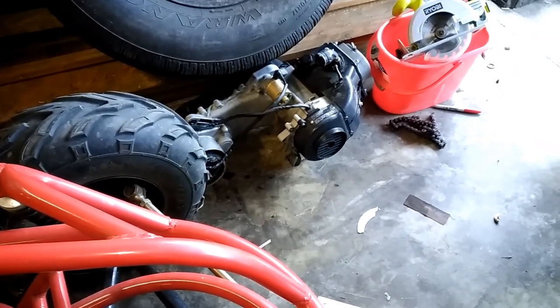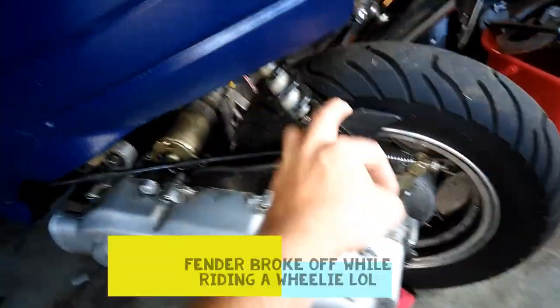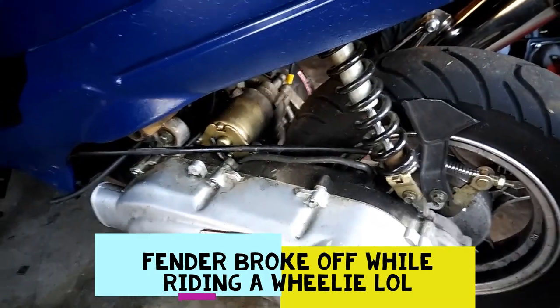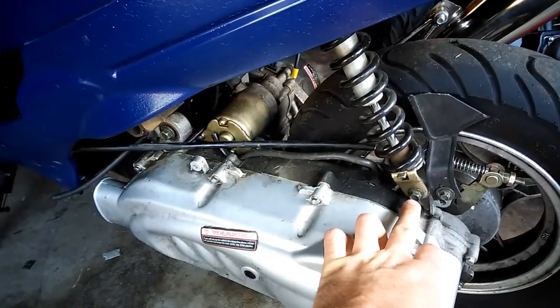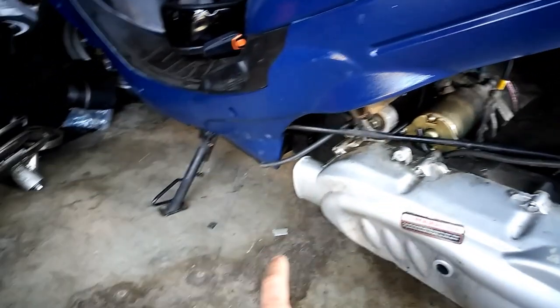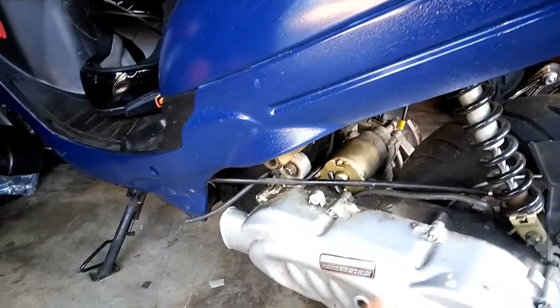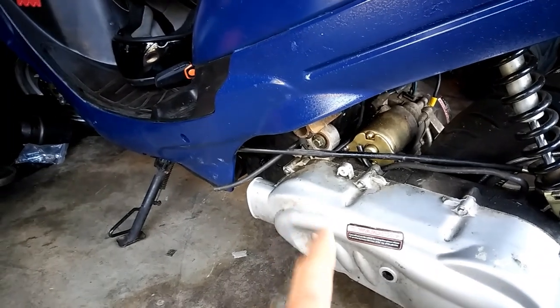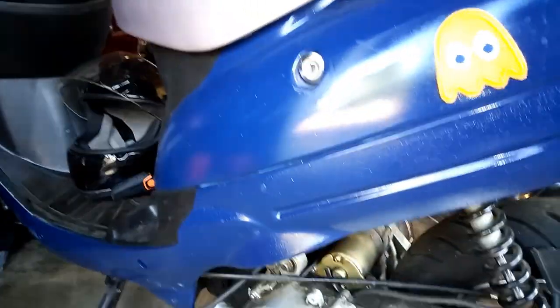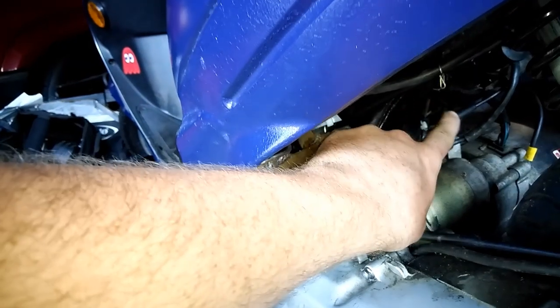Here's the 50 and here's the 150. I've gotten a couple questions as to how I did this. These engines are pretty simple. They're held in with one bolt — the motor mount bolt here on the 150. On the 50, you've got your motor mount bolt up under this area here. So to make this go from a bottom to a top mount frame, as you can see, it is just a little 50cc frame. The 150 has this bar for the motor mount that comes across.